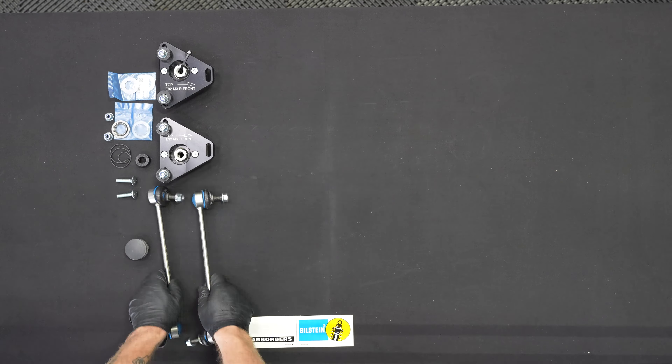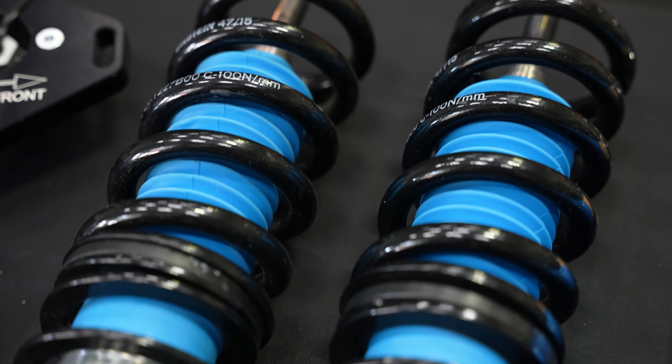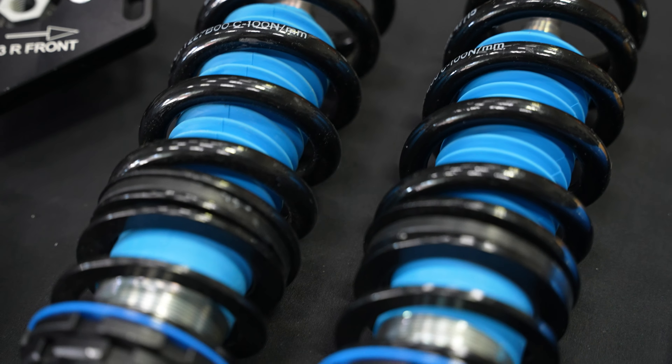Adam went ahead and mocked up the Bilstein with the spindle, and it's on the car. We have a comparison below with the stock damper that came off the E90 M3. It has H&R springs on it, but it's a progressive spring just like the factory. There's no camber adjustment on the top mount, and it's pretty much a soft setup — not really for track, not really for dual purpose. On the Bilstein Club Sport, it has two adjustments: one for rebound and one for compression, with 10 clicks each. So you could technically have a hundred-plus different settings.